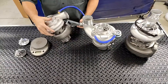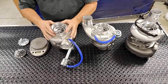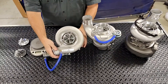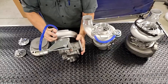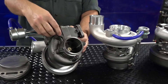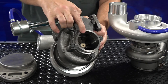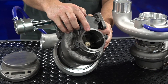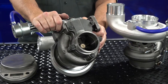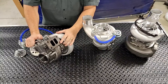You can use your factory elbow, your factory oil feed line if it's not all old and rusty. So for the most part, factory elbow connection. The factory exhaust elbow would go here. Some of those guys had phone calls about the factory updated engine brakes — there's a Banks engine brake that would bolt to the back of this and some other aftermarket ones. Some guys really like that in the older 12-valve tow rigs. Your typical good T3 flange fits on the factory manifold.